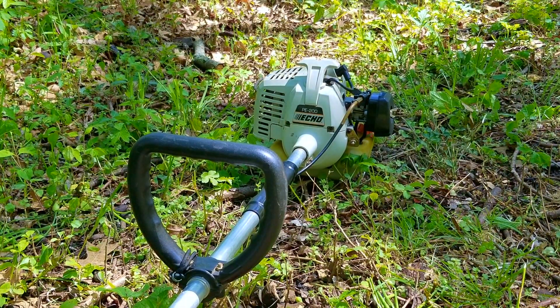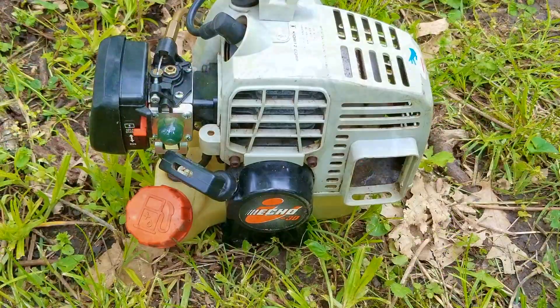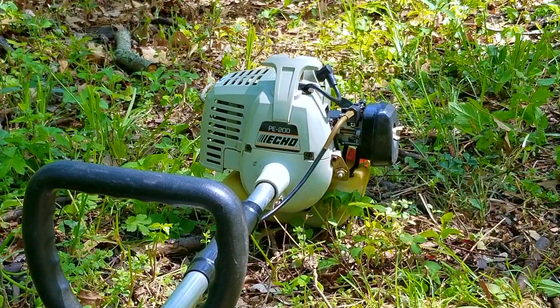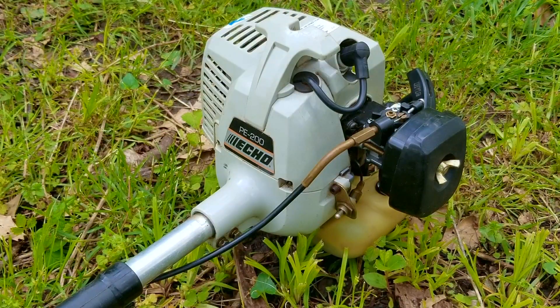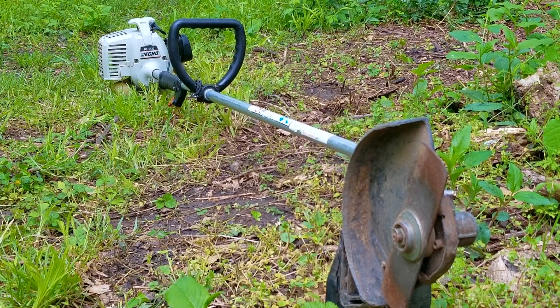Overall, it's about the best we can hope for when dealing with an engine that's got a few miles on it. Is it working like brand new? Absolutely not, but it's probably better than the new overpriced equipment you find at the big box stores. Another reason why this edger wouldn't run correctly would be a clogged spark arrestor screen, but as you can tell from this one, that's not the issue. If you think yours might be the issue, try removing the screen and cleaning it. My question is: would you rather buy a working used piece of equipment for not a lot of money, or would you buy a new one instead? I would absolutely love to buy new stuff, but with the way things are right now, I would always consider buying used first. Thank you for watching — I really do appreciate your time here. Please feel free to ask me any questions about this project or your own projects, and I hope to see you in the next video.